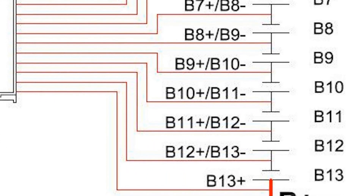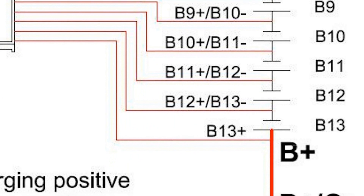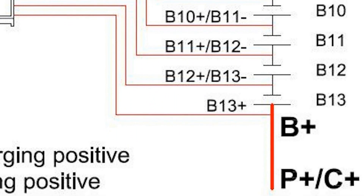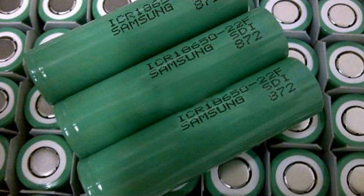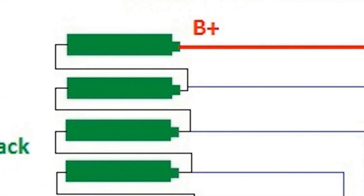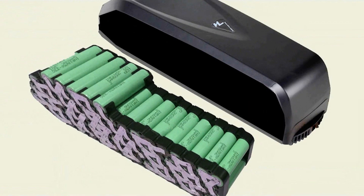The BMS is controlling items such as voltage — total voltage or voltage of individual cells — temperature, average temperature or temperatures of individual cells, state of charge or depth of discharge to indicate the charge level of the battery, state of health as a measurement of the overall condition of the battery, and the current in or current out of the battery.